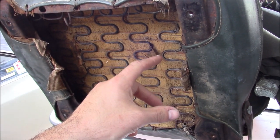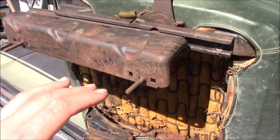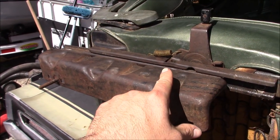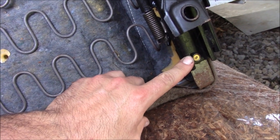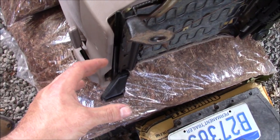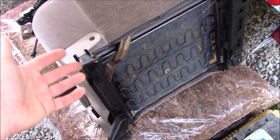Here's a quick rundown on how to do that. The first step to adapting these seats over is to make sure you go out and buy some good quality angle iron before you do any real looking at the seats to see how they fit — and then promptly discover you don't need it. Once you get the seats out, you'll see that the bottom frames are connected with just four bolts to the bottom of the seat. And by a good stroke of luck, the Ford Escort seats are also held on by a suspiciously close-looking set of four bolts. We were originally going to build some angle brackets to adapt over the feet that came with the Escort seats, but with all the height differences, width changes, and mounting the pads at an angle, that wasn't going to be any fun.